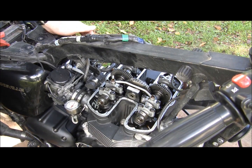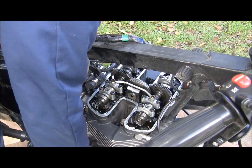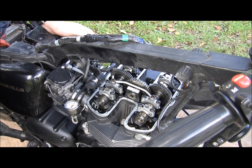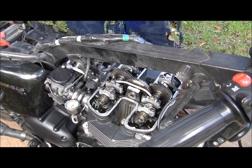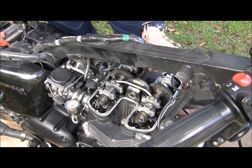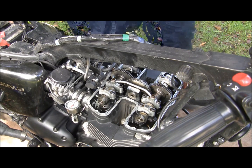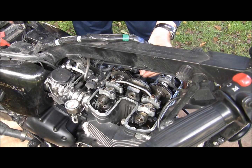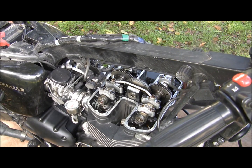Let's get the other side, so we're going to have to get the lobes up. As I said before in the other ones, if you want more detail, just check out the other videos on this. There's more work in one. We got 22 here. It's too tight. Let's say 22 on that one. So 22 on I4. Tight 23. You can call it 23 on I3.